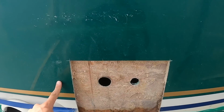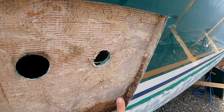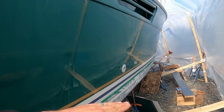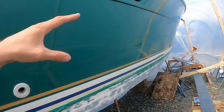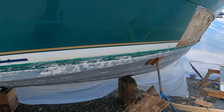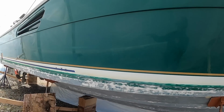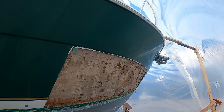Here we go. Wet, dry, no delamination, delaminated. And we're hoping as we go further down the hull side that, again, here up is dry, and here down, where there was a through hull, is where the wetness is. So we're getting there. I'll probably get some time-lapse footage of Jose continuing to cut and grind out the areas that are delaminated, to see how much we actually have to remove from this hull side.